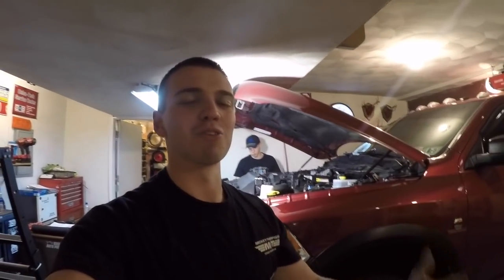It's the biggest treat ever to work on these trucks, like I was saying earlier. It's so much easier than a Duramax and definitely easier than a Power Stroke, that's for sure. And something simple like this will pretty much just help the customer get peace of mind, so he doesn't have to worry about his head gasket being pushed in the future. It happened to one of his other trucks, so now with this one, you don't have to worry about it with those ARP studs in there. The turbochargers on these trucks sometimes malfunction and create too much cylinder pressure, and that's what ends up pushing the head gasket, just being tuned on this truck.